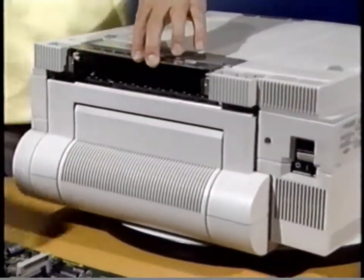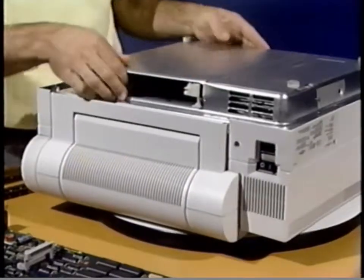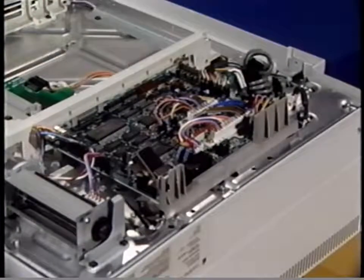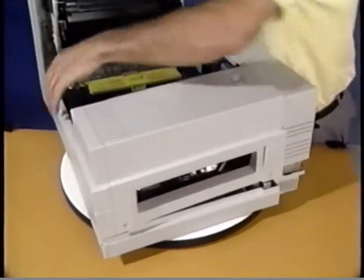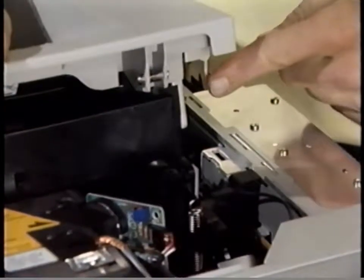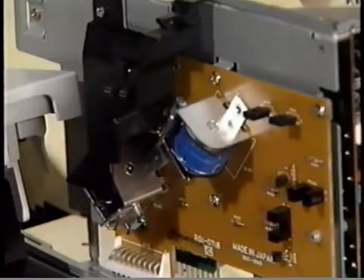The DC controller PCA is located above the IO PCA on the bottom of the printer. The DC controller PCA is the LaserWriter 2's command center. It controls and monitors the other three systems of the printer: power distribution, image formation, and pickup feed systems. When the upper unit is opened, the interlock switch cuts off power to the printer. Here is the interlock switch and interlock switch lever. Next to the DC power supply and main motor assembly on the distribution PCA are the toner cartridge sensitivity switches SW301 and SW302. These switches help the DC controller match laser beam intensity to drum sensitivity.